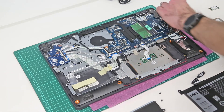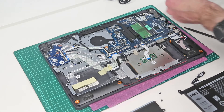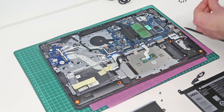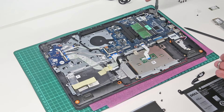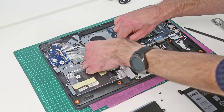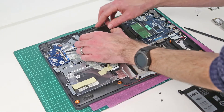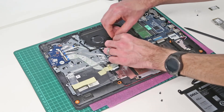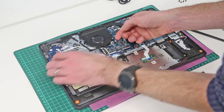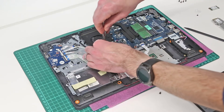There's nothing more frustrating than putting the laptop back together and realising you've missed the touchpad, or the keyboard, or something similar. We're then going to refit the hinge and reconnect the screen. Replace the fan, slotting that in under the heat sink. Make sure you plug in the fan, because again nothing more frustrating than turning the machine on and realising a few minutes later that the fan is not connected and everything's got rather hot. Push that fan connector in and refit the two screws.